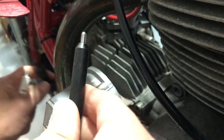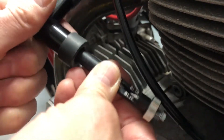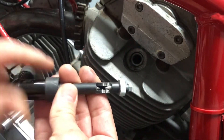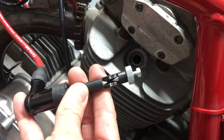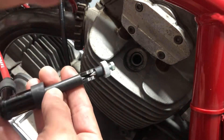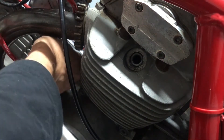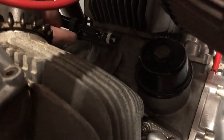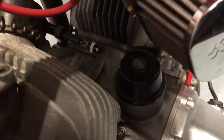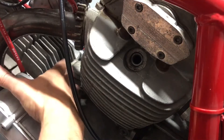Take your spark plug wire and set the tester into it — you'll hear it snap into place. Make sure this end is grounded, and keep it away from the spark plug hole, because that area is filled with fuel fumes. You don't want that spark to ignite the fuel — that would be bad. Tuck the tester on top of the engine, making sure the grounded end is touching the block for a good ground, then turn the bike on.